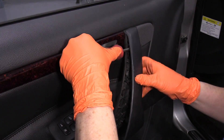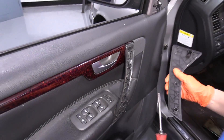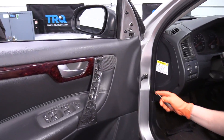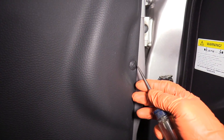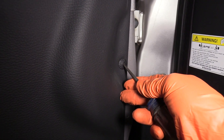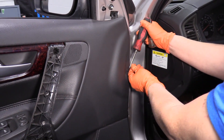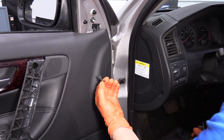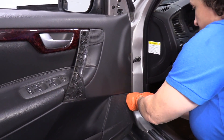To get the top, I like to put the screwdriver up here and just push like that. Set that aside. Now they have these body clips that are little push pins. See the center tab? You just take an object — a small screwdriver or a punch — and push it in one step like that. Then you can take a flat head screwdriver and just pry it out a little bit. It pops right out. I'm going to go around and do all of them.